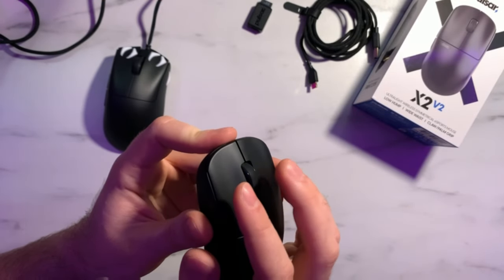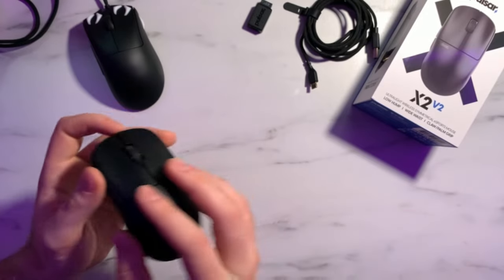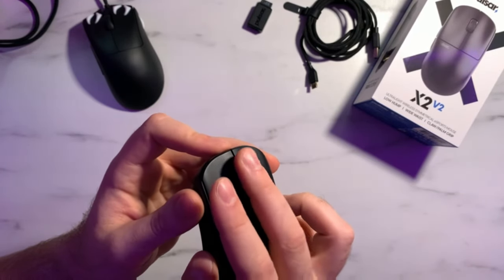The scroll wheel is also getting changes. The scroll wheel click uses the same Wano mechanicals as the side buttons, but the encoder has been changed to the Pulsar blue encoder. The scroll click feels more properly tensioned than the side buttons since it goes to the main board, not a daughter board. The scroll wheel has a medium resistance — a little stronger than the DeathAdder V3 — with a very nice tactile hump for each scroll point. I didn't run into any issues with the encoder not sending a signal, and overall it feels quite solid.